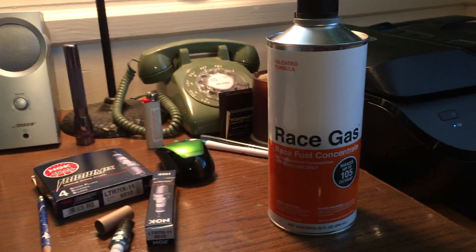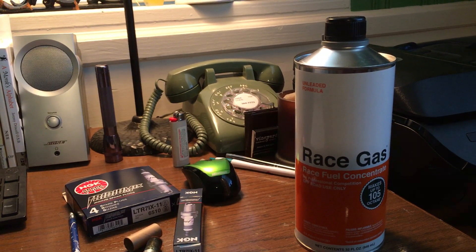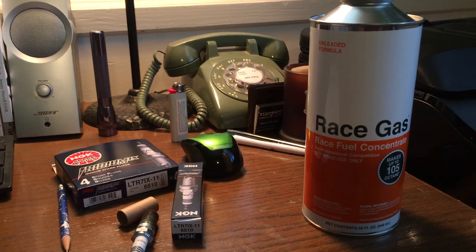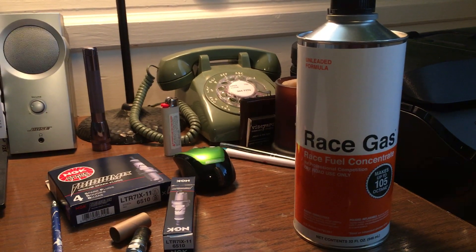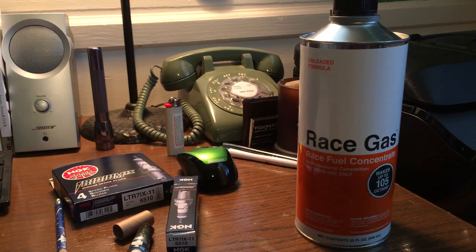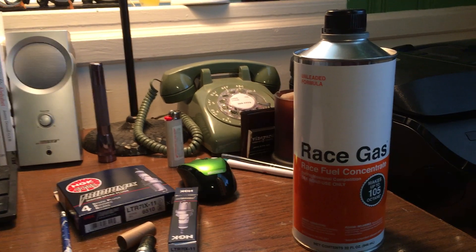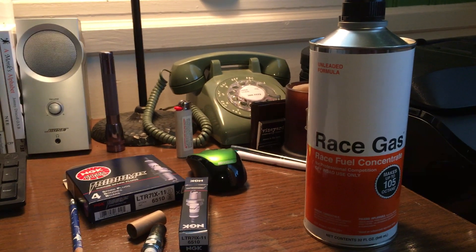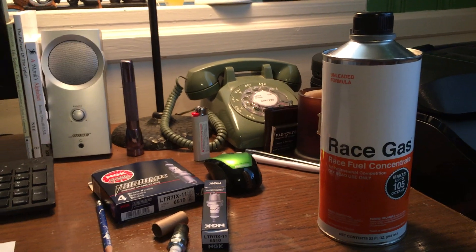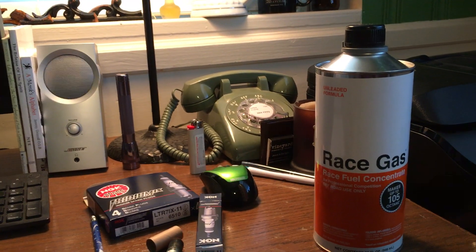Once you've got all your hardware on, there are three options for the Fiesta ST. Option one is ethanol blend — it's great and cheap, though you lose gas mileage, but it's not available where I live. Option two is water-meth injection — great option, keeps things cleaner in your engine and it's always there. But the startup cost is around $800 to $2,000 for a good meth kit, running all the lines, a switch, and hard charge pipes with the meth port.